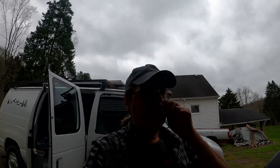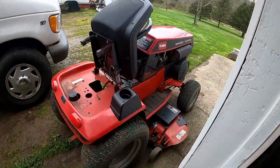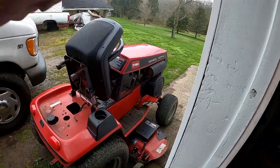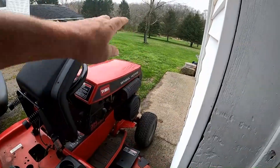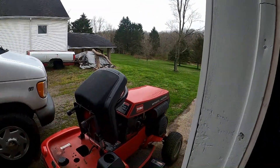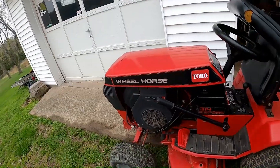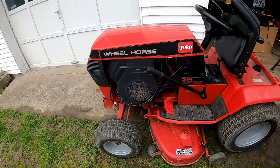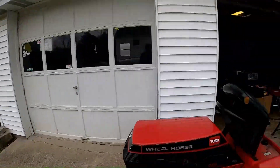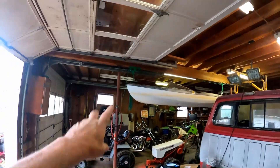I've got some other jobs to do this evening - one is this lawn tractor. It's my buddy's nephew's; he's not real mechanically inclined and just likes someone to look at it at the beginning of each season. It wouldn't start - it actually had a bad battery connection. That's all cleaned up, a proper bolt put in to hold it correctly, I blew out the dead grass from the engine and cooling fins, and the air cleaner was packed full and needed it badly. It's running now and I just have to change the oil - a new filter is coming today. He can pick it up tomorrow.